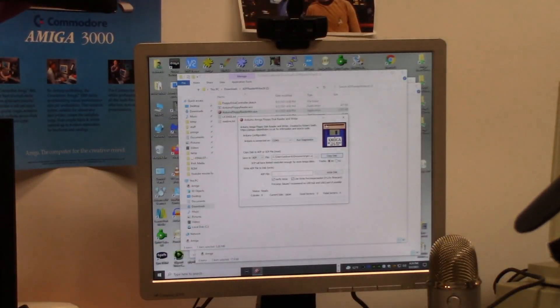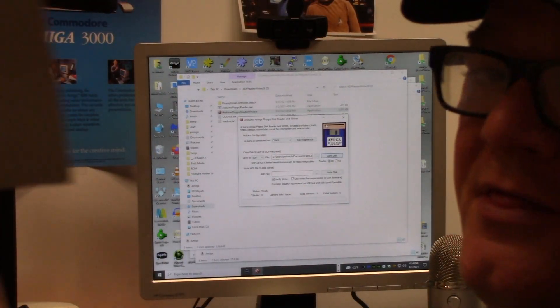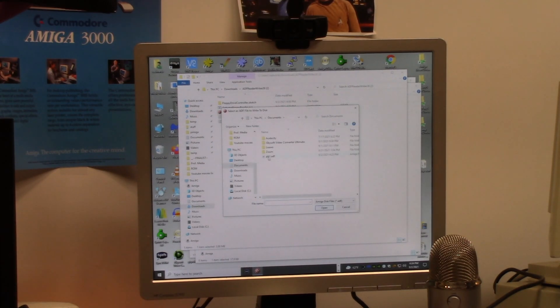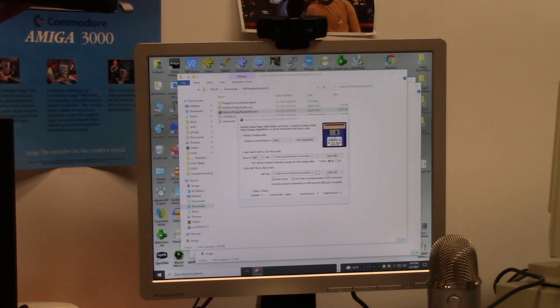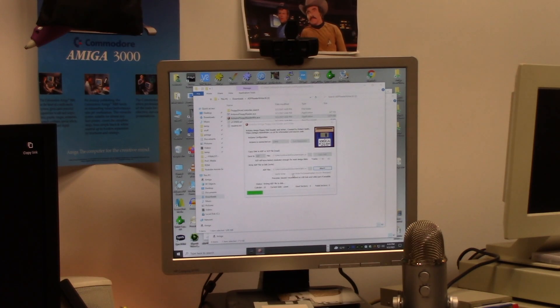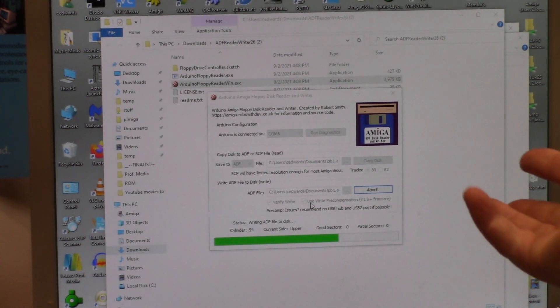Now how are we going to test this? We're actually going to test it two ways. This is reading a disk. I am then going to put a blank floppy in and we're going to write the same disk — I have some gray ones here — and then we're going to boot said disk in the Amiga 1000. Your ADF was read successfully. So now I want to take this disk out. We're going to grab a blank 3M double-sided double-density disk, put that in, and I'm going to go Write Disk. PB1.ADF — Write. It pauses for a second, there it goes, it's writing the disk. Cylinder 1. My main benefit is reading — I want to read a lot of my disks that I cannot find either in the archive or online. Installation is super fast, but it is still a floppy, so hope you got some time.